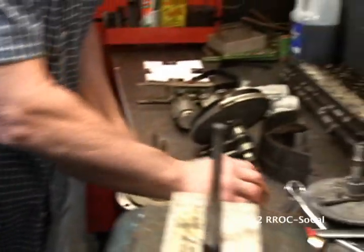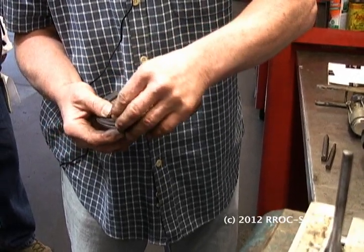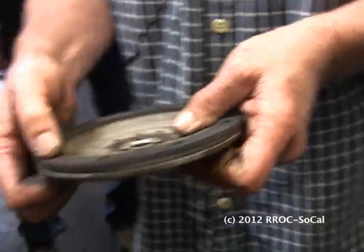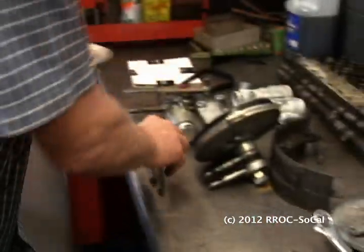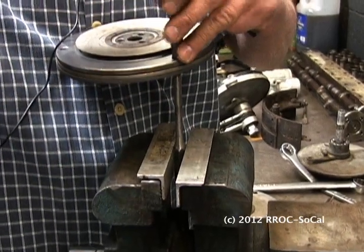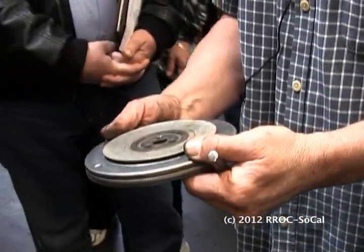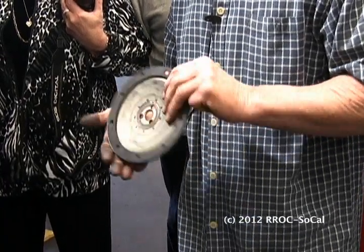The rivets are a little tricky — it's almost like looking at grass, right? You have three at a time because there are three holes on this back plate. See that rivet? It should go in that hole. That rivet goes in there, and if you look at the other side you can see the other side of the rivet. You can't take the center washer off because it's riveted around the center. I just set it up here and do my balancing act — you spread a little bit and then hit it with another punch. There are nine rivets altogether. Do three at one shot, then turn it, then three more, then all the way down. Stay away from that spring plate — it snaps fast.